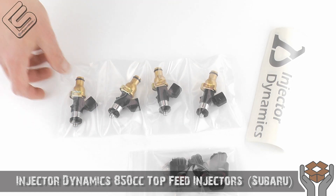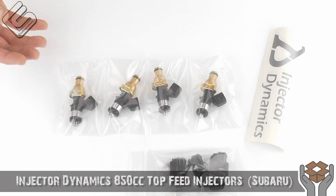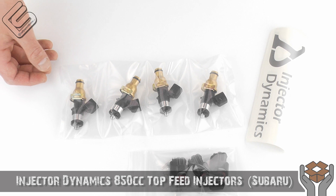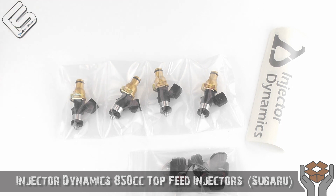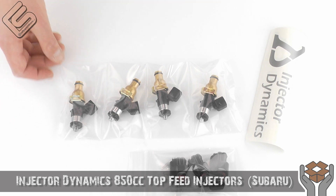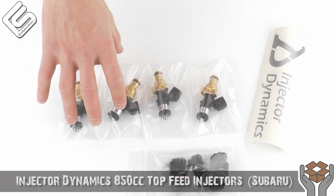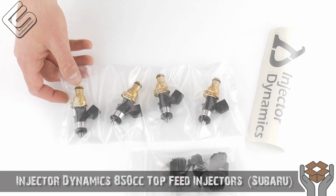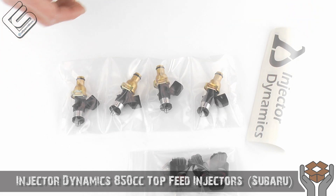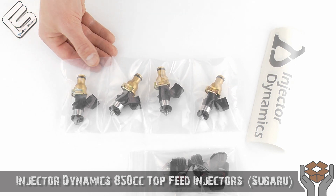You kind of get the best of both worlds. You can have a big injector, so when you need it — your turbo's spooling up, you're running full boost — you've got all that fuel to make a nice consistent tune and keep the car reliable. But when you're just putting around town, they spray just like stock, which is very nice. You can still have decent fuel economy, good idle, good drivability when you're not romping on the car. And they come with a one-year limited warranty. It's just a great product all around — perfect for anybody going for big power, E85, anything like that, where you just need a lot more injector than the stock ones will give you.